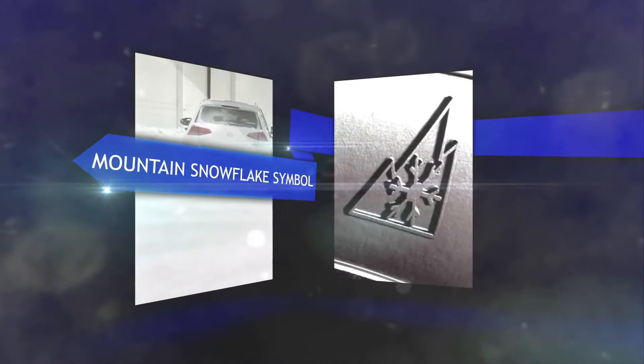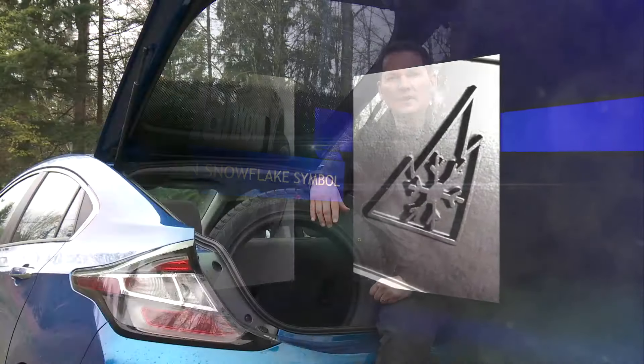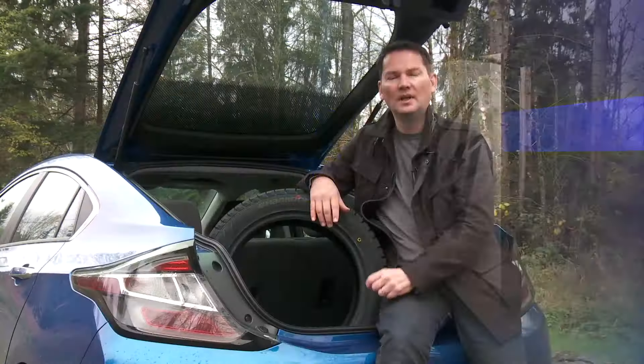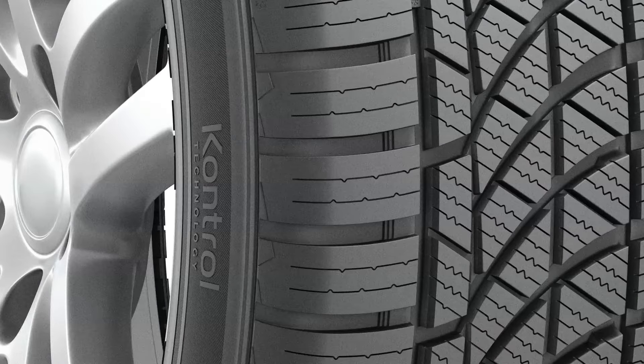The most important thing is that all-season tires do not come with the mountain snowflake symbol on the side. This symbol indicates that the Kinergy 4S has passed the Transport Canada slip test, allowing it to be used in winter. Make sure to look for that symbol when you're shopping to ensure the tire meets the standard for our cold and snowy climate. The dual-sided nature of this tire with the winter grip and the summer performance met in the middle with all-weather capability is great, plus the added benefit that you don't have to change your tires twice a year.